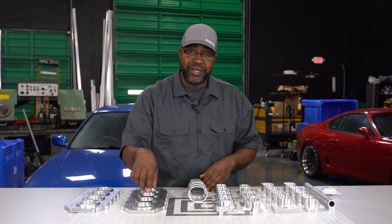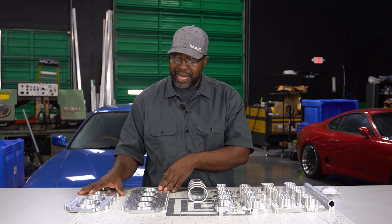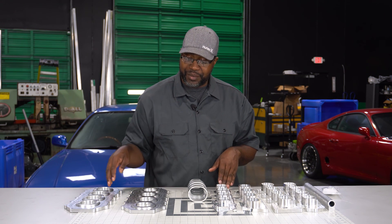The spacing is offered in two different configurations. For Hondas, I have an 81mm bolt bore spacing that works with all the Honda B series such as the B16 and B18. I also offer larger spacing of 86mm, which works with all the larger displacement Honda motors such as the H series, the H22, the S2000 — which is also 86mm — and the Honda K series.